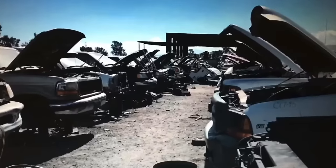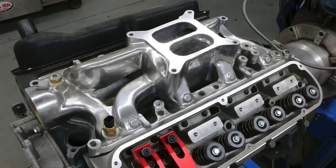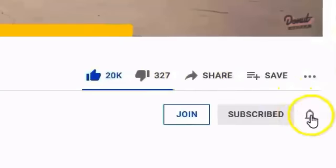The low-buck option: go to the wrecking yard, get a 5-liter Explorer motor with the already-good GT40 heads, put springs and a camshaft in it, and you'll get partway to what we showed here. But better cylinder heads with less camshaft is always a better way to go. With the right cylinder heads, camshaft, and intake manifold, the 5-liter Ford continues to make good power. I'm Richard Oldner — like, share, subscribe, and hit the bell. I'll keep testing.